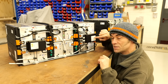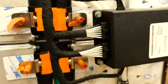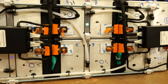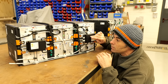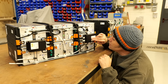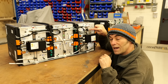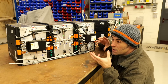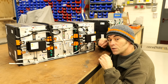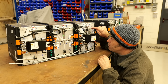This is the BMS, battery management system. What this is doing is monitoring the cell voltages through these wires here - all the individual cells within these modules that make up a pack - ensuring they are between the voltages you really want, which in this pack is probably somewhere around 3.3 volts up to about 4.2 volts. There are also wires monitoring temperatures, with temperature sensors within the battery modules themselves. A battery is happy if it's above about zero degrees Celsius and below around 40 degrees Celsius.